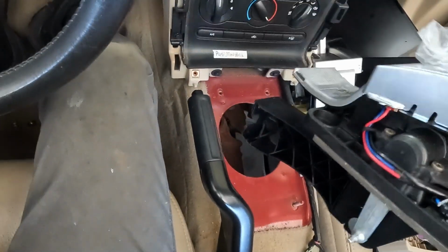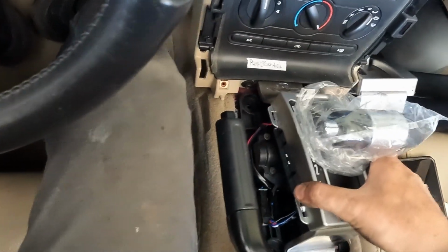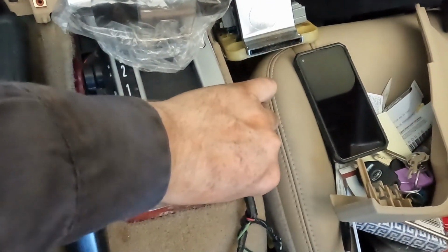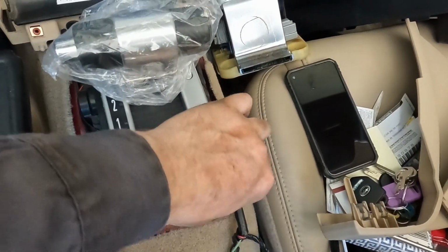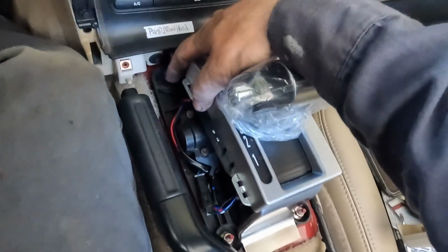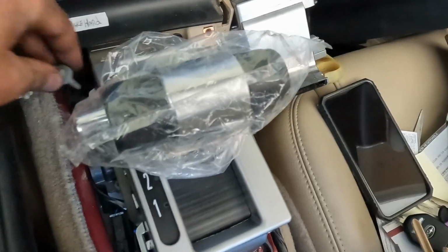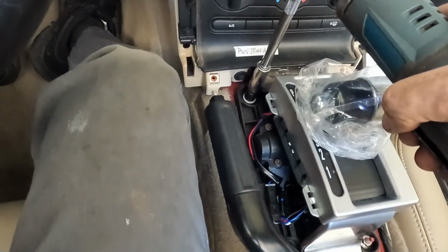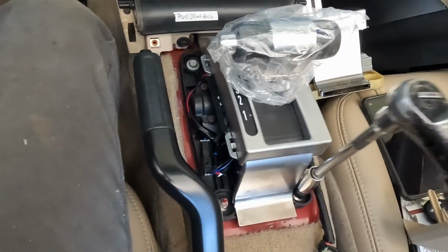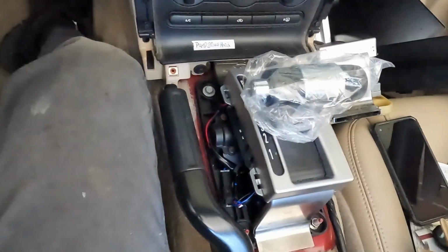Put on our new one. That goes in like that. Okay. Boom, locks in. We'll go ahead and put those nuts on just to hold it in place. All right, we'll just snug these down a little. Perfect. Not all the way, because we still have to align the front and get those two bolts in. You know, let's just do that. Nothing preventing us from doing that. And just good and snug. I don't have a torque spec, but use your judgment. They don't have to be crazy tight, but you do want them good and snug.